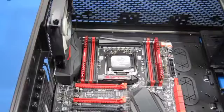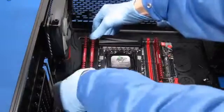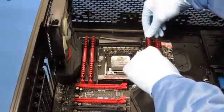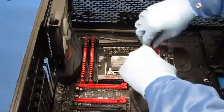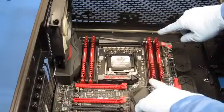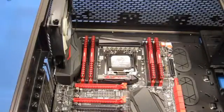The book says Channel One — I'm going to put them in like this. I put pressure at the back side here and then press in, which causes the little latch to click. Very positive feedback. I feel some memory connectors aren't quite that positive. Next: CPU.